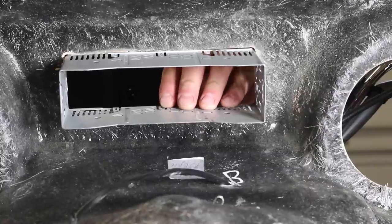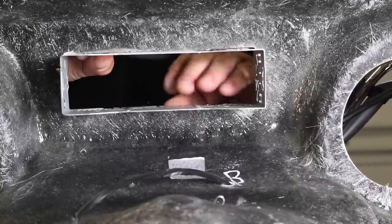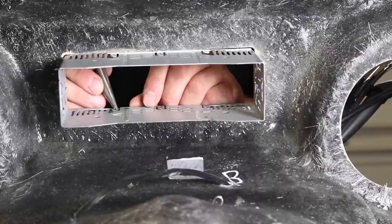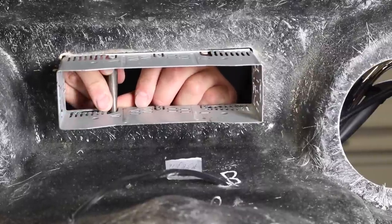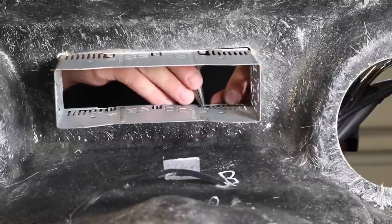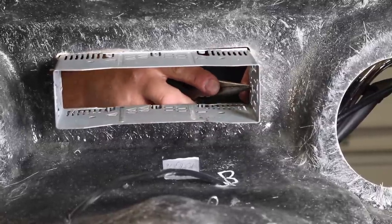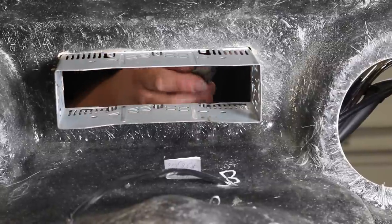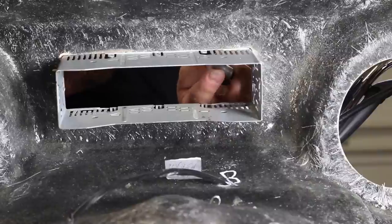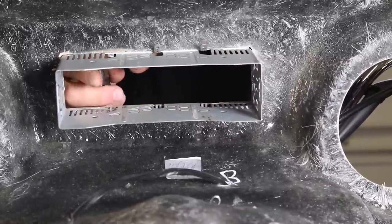Now Kevin's working on the front side and you're looking at the cage from the back side. You'll see there are lots of little tabs in there, and what you do is push these tabs down and wrap them up against the fiberglass. There are several of them — just go all the way around and push them all down and get it snugged in there. When he gets done using all those tabs all the way around, it's going to securely mount that cage to the fiberglass fairing.